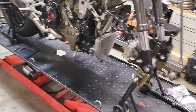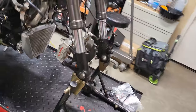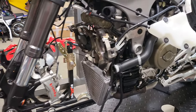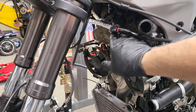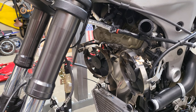Got the front shroud removed. I put the calipers temporarily back where they belong just to keep that out of the way. I had them on a bungee cord; I put the bungee cord to hold this bottle back. Next, we're going to start getting into removing these bolts. First things first, I'm going to pull the ignition coils out and start removing piece by piece. Let me get some lights shining on what we're doing and I'll step you through this process.